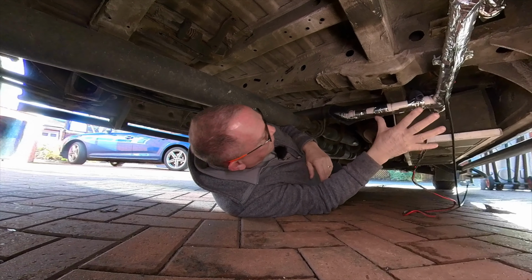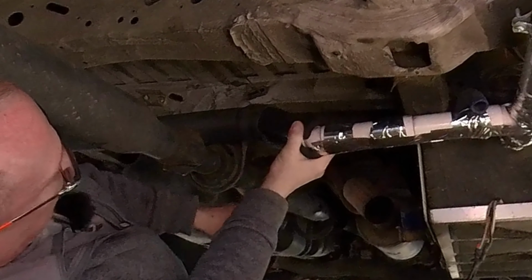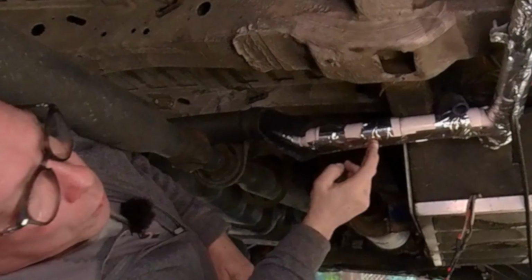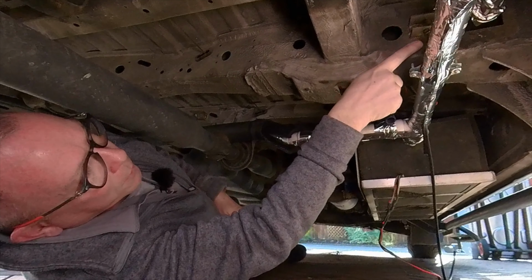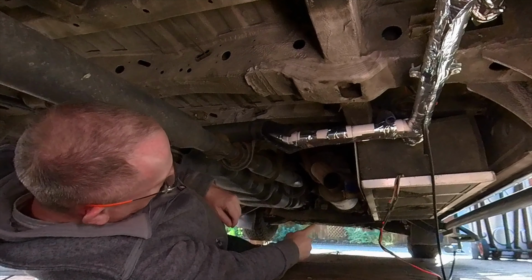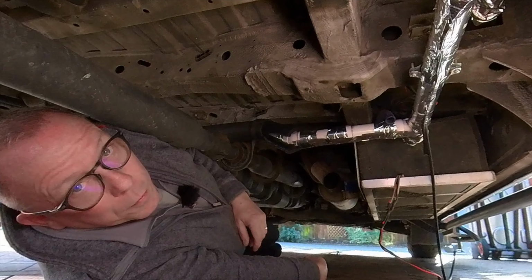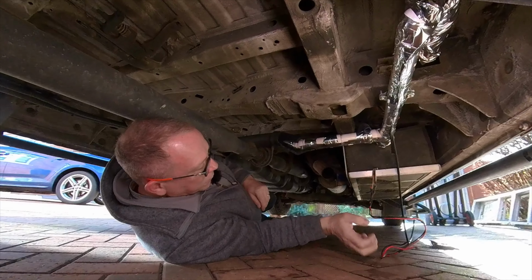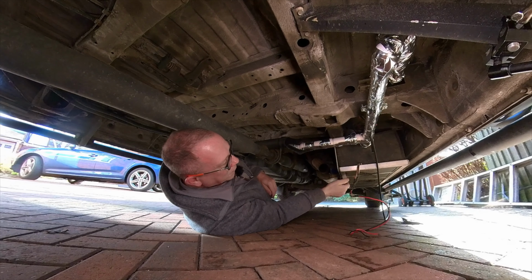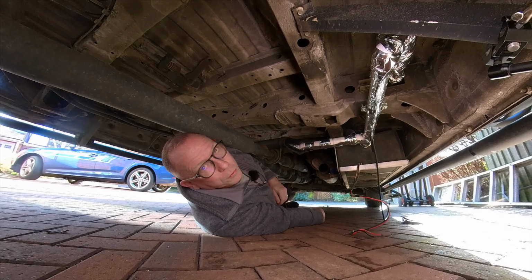Okay, now we're on the other side of the van and you can see how the insulation is taking shape across here. This has got all the electrical heating cables already attached to it, going up here for the shower waste, and I'm also going to put some of this heating cable around the drain valve, which is down here, so that that hopefully doesn't freeze. Then all that's left to do is to wire up these wires, which go to the heating pads under the tank, and then connect up the heating cables back through to the electrical system in the garage.